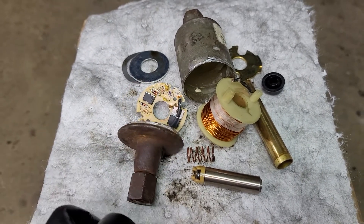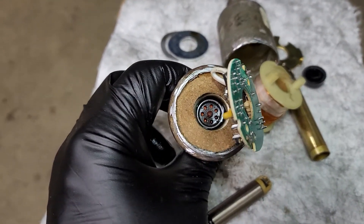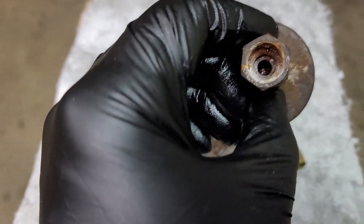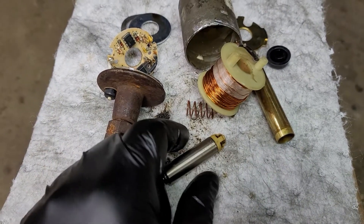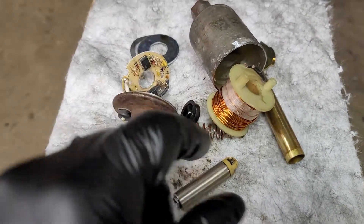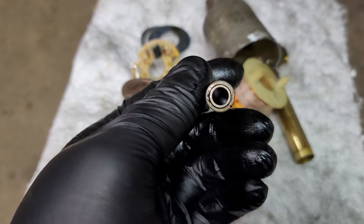Simple yet effective. In the end of this one there is another little rubber flapper — that little red piece in there is one of those light little flappers that lets fuel by but not back. Inside of here there was a gasket but no screen — nothing to really prevent anything from going in here.